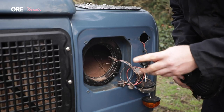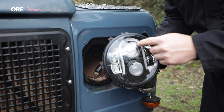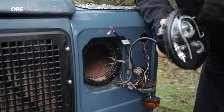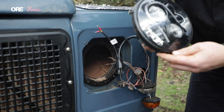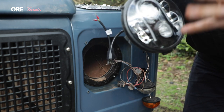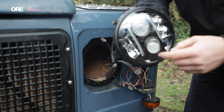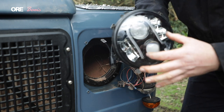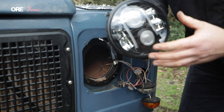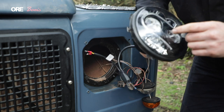The connectors are just the same as before, and these are for the DRLs — the daytime running lights — and that's what this bit here is, you can see that there. That can just light up either with a switch of your choosing. There are certain regulations but you can look that up yourself. Daytime running lights with the side lights can be a bit dodgy, but if you find a live wire that comes on with the ignition — the heater for example — you could actually have that running any time the car's on and that would look quite cool. I'm going to sort that out later, have a think about what I want to do, and just wire it into the mains for now, and then maybe do these into the side lights in the future.